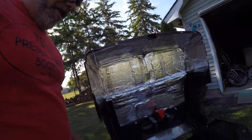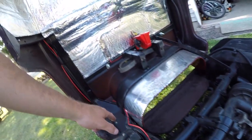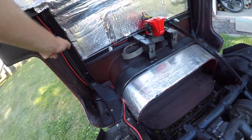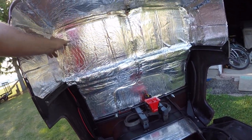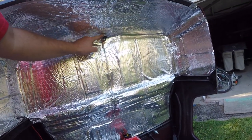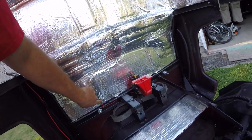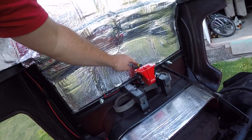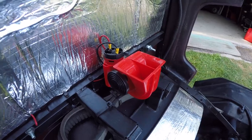Here's how I did it: I ran a power wire from the battery all the way along here, up here, in behind this tape so it blends in, and into the starter button. Out of the starter button, down here, and over to the horn. Then I had the ground come off and grounded it right to the cart. There's the horn — they're on eBay, pretty cheap. I'll put the link below in case you guys want one.